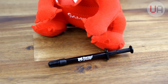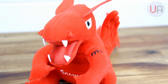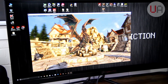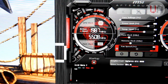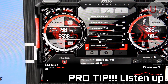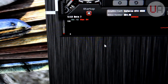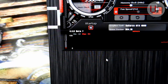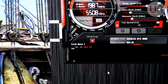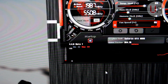Just like in the FTW3 video, I'm going to use Thermal Grizzly's Conductonaut, because I'm pretty familiar with it and it's what I've used in the other videos. For software, just to keep things in line, I'll be using Unigine Heaven Benchmark to put load onto the card and test its stability, and I'll be using MSI Afterburner, which in my opinion is still the best graphics card overclocking software available. Pro tip: in the description you'll find two links to download Afterburner — one is the latest official version, and the other is a beta version link from a forum, which unlocks voltage control on the GTX 1080 Ti. The beta versions can be tricky to find even if you know they exist, so you're welcome.